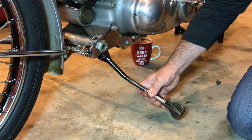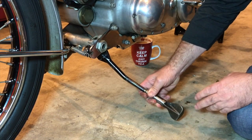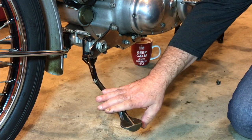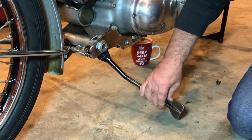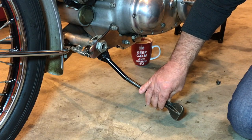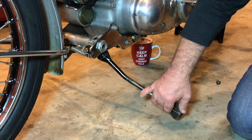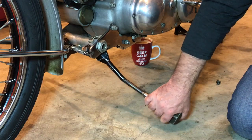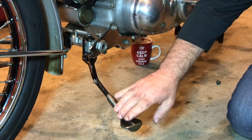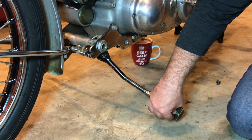What I'm seeing right away is they're about an inch too high. I think these have been modified at some point, no doubt to make for a better side stand, but when they're like this they're hitting the stop and not touching the ground. I could take the bike off the rear stand but I don't want to — I really like that rear stand for the stability it provides. So I'll probably just put a little jack under the bike while I start working on the top end. That's a shame but something to be mindful of in the future.